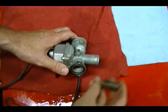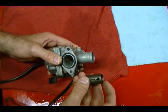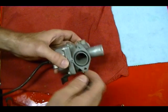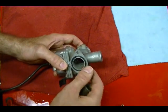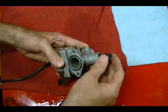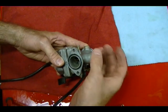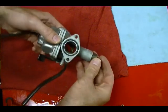The other type is a constant velocity carburetor. The only difference is that instead of the cable directly pulling up on the slide, vacuum from the engine pulls it up. On those carburetors there's usually a butterfly connected to your throttle cable — when you give it gas the butterfly opens up and vacuum from the engine causes the slide to raise. On top, connected to this slide, is a rubber diaphragm, and when the vacuum changes it pulls up on the slide and causes it to raise up.